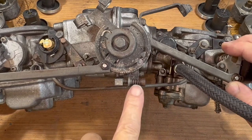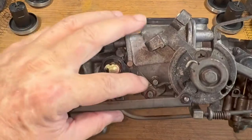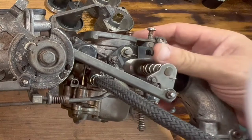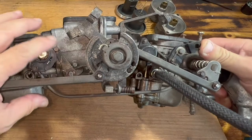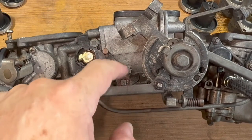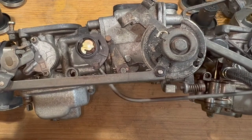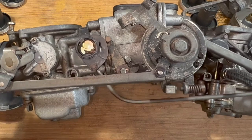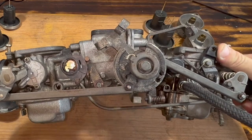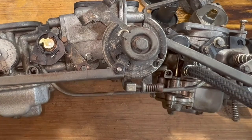Here's idle speed. Over here we have the choke — see, here's the actual choke lever. This cam right here moves this lever, which operates the throttle. So when you put the choke on, it gives it a high idle, then back down to your idle screw right there.